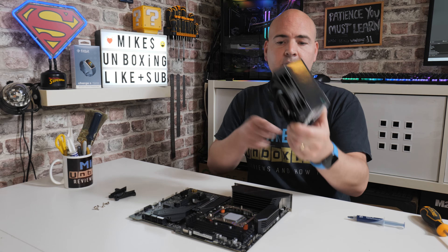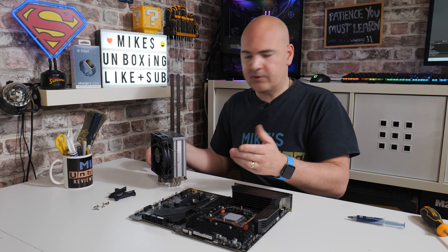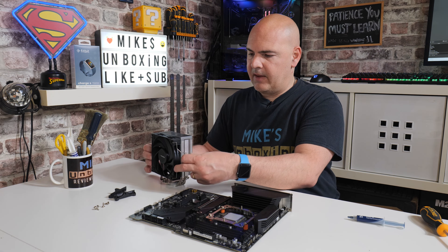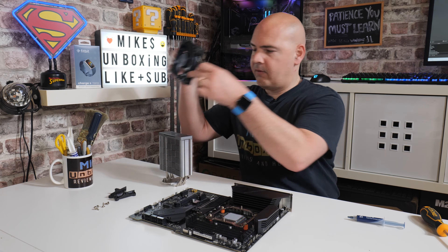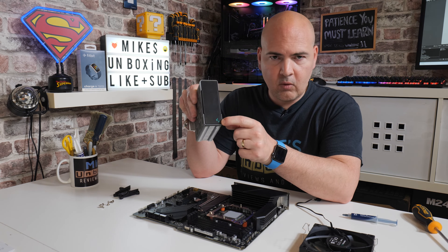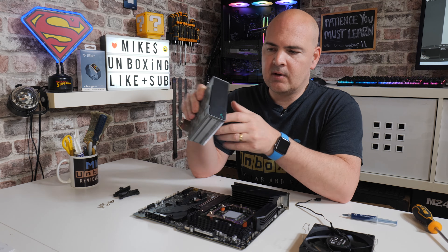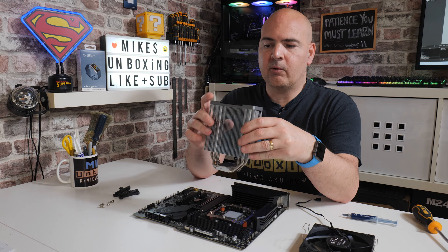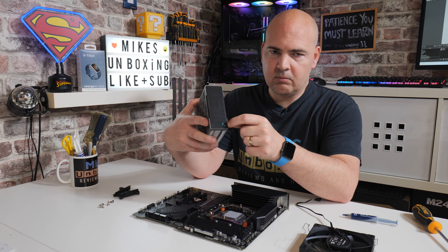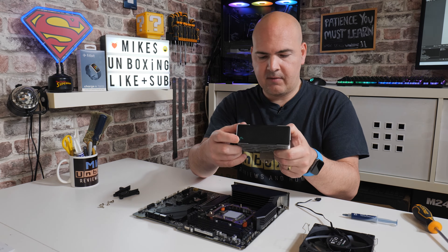In order to install the cooler, you're going to need to first remove the fan itself. Put it onto a stable surface and with your fingers, just pull the spring clips back and out — that will release the fan from the heatsink. With the heatsink, there is a small logo at the bottom. Depending on which way up you want your logo shown, normally it would be towards the bottom — showing the DC or Deepcool branding in a slightly stylised way — so that should be towards the bottom, nearest your graphics card.